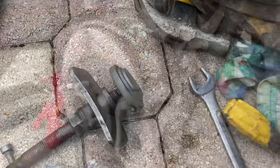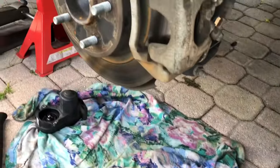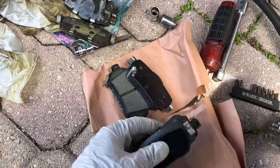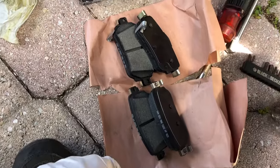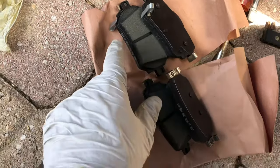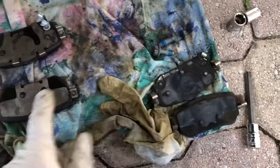I got the new brake pads — these are the new ones. The other ones were for the manual parking brake, so if you have this electrical brake you need different brake pads. The dealer has them — I couldn't find them at the local auto parts store, so I had to go to the dealer. These are the correct ones. You have to remove the plates from the old ones and transfer them to the new ones, because the new ones don't come with the plates. These are the new ones — that's the old ones — I transferred the plates.